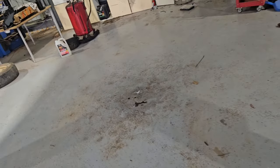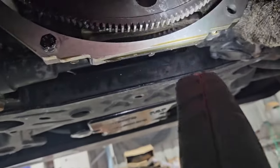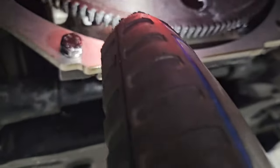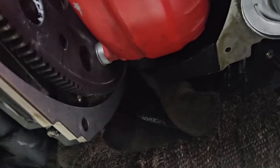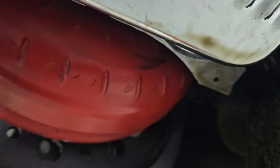If you remember, we had a rocker cover gasket leak and we replaced that, but we've still got oil leaking out of it — it's absolutely pouring out, flicking it all over the extractor, smoking and everything. It's coming from up behind there. It's got a brand new plate and rear main seal on it, and when you look up there, it doesn't look like the rear main seal's leaking. So it's either the plate, or the sump, or something like that.